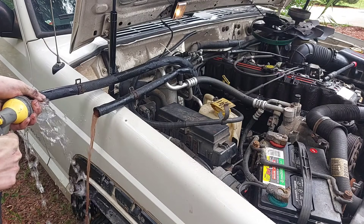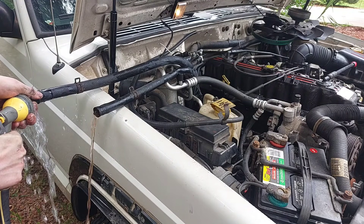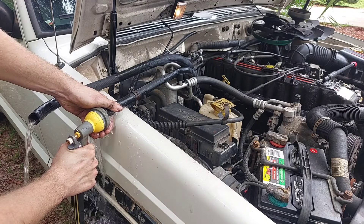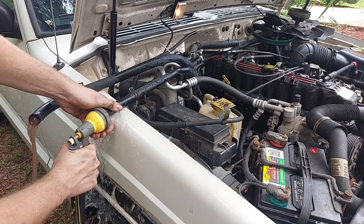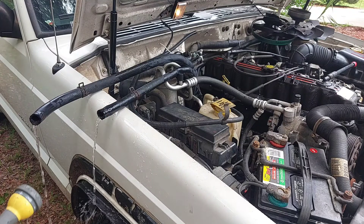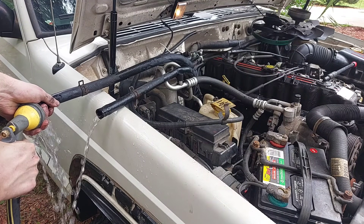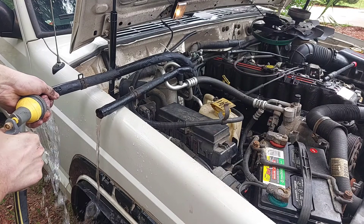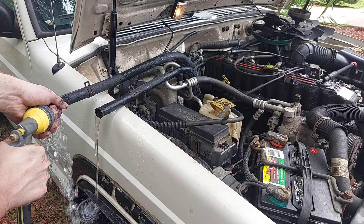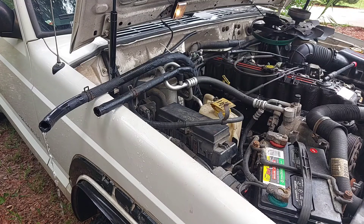You can see it's starting to clear up. Going back and forth through the heater core like this is really all you have to do to flush it. The first time I did this when it had never been flushed, it took half an hour before the water came out clear. This time, after only a year of contamination, it only took about 30 seconds to a minute.